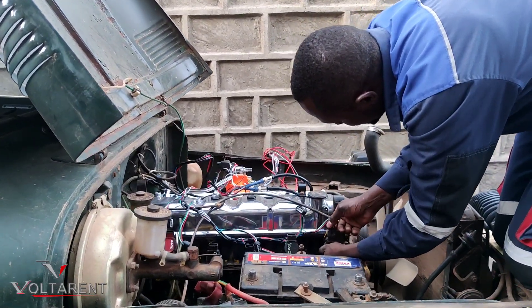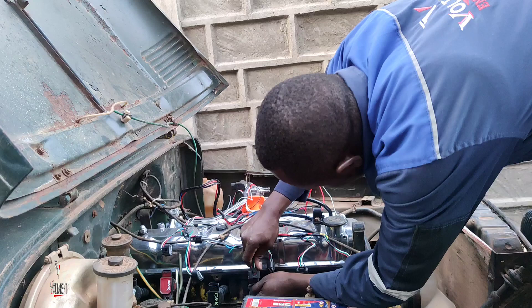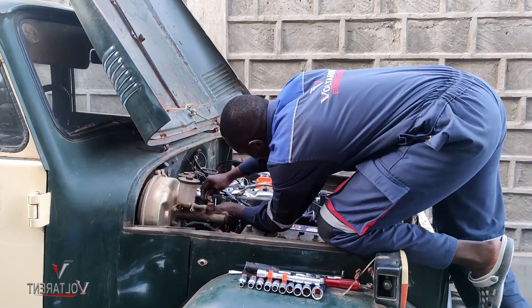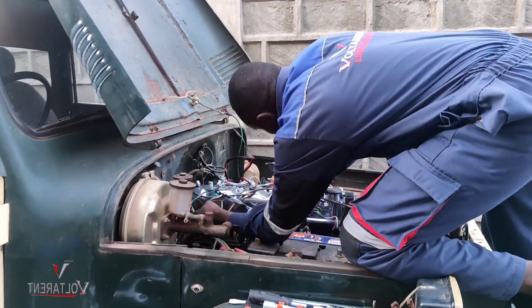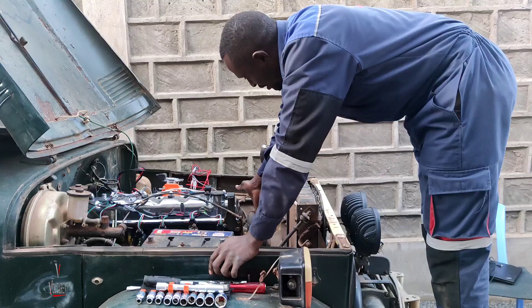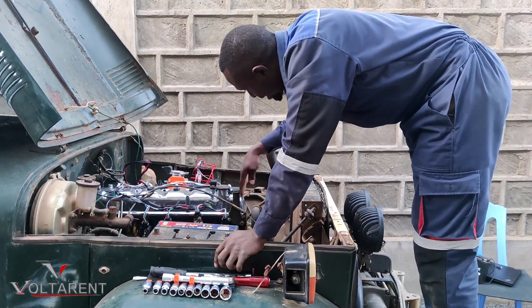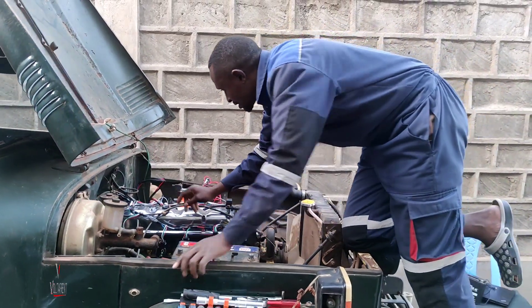There's number 1, number 2, number 3, number 4, this is 5, this is cylinder number 6. So how I know it will go cylinder 1: cylinder 1 is from the pulley side. So I'll make sure from this side the immediate cylinder is 1, 2, 3 respectively. After cylinder 6.